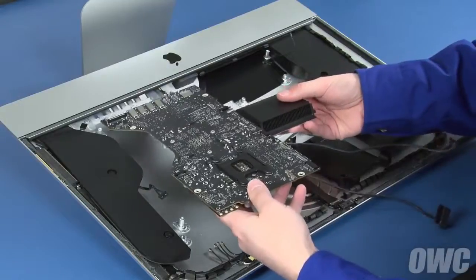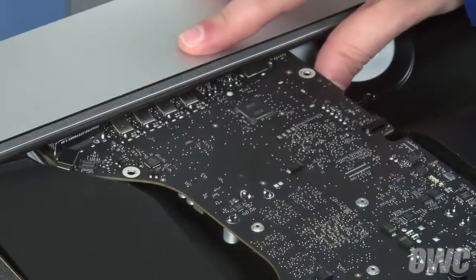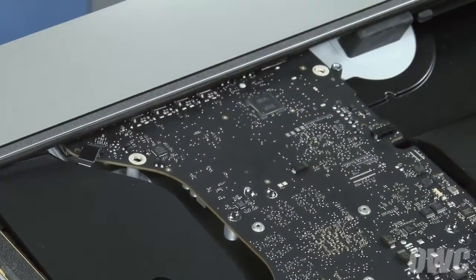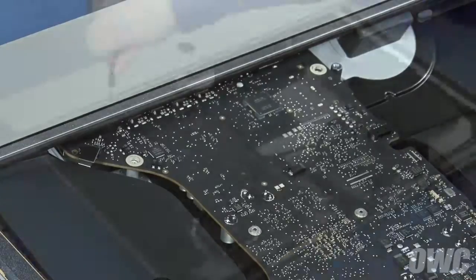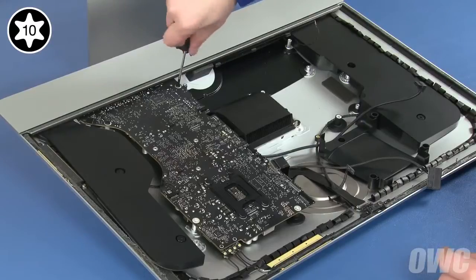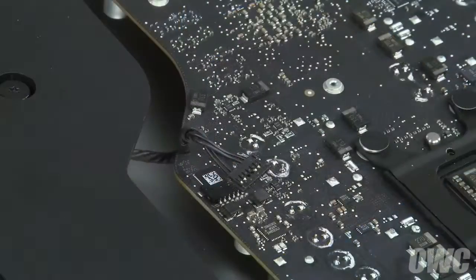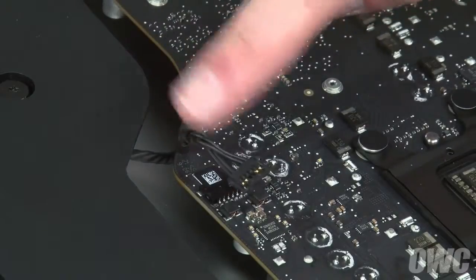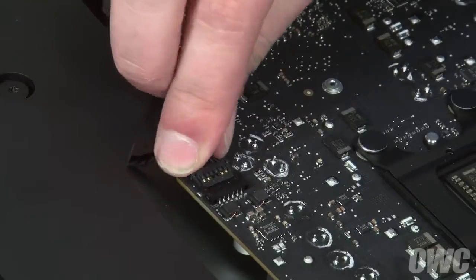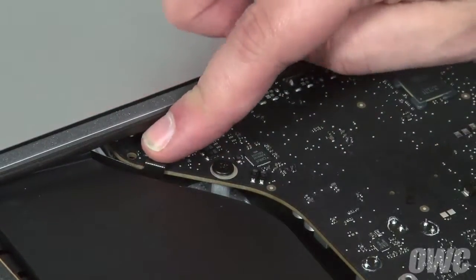You may now place the logic board back into the iMac, again being careful not to accidentally damage any of the surface mounted components. It may take a little maneuvering to get it to fit into place. After making sure no cables are trapped underneath, you can replace the four screws that hold the logic board in place. You can then reattach the cables, starting with this speaker cable, which just slides into place. This connector simply lines up over its socket on the logic board and snaps together.